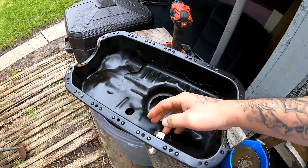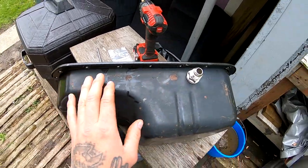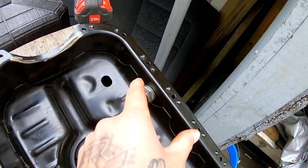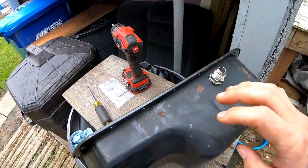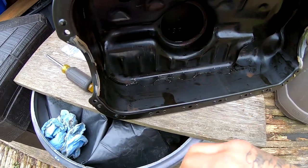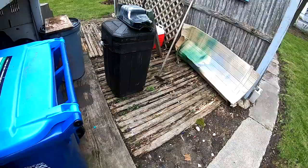I'm gonna take it off, and after that I'm gonna scuff the whole thing on the outside and give it a quick paint job so I don't have any more surface rust. I also like to apply RTV on the inside around the edging after it's all tightened down. Don't forget about the little metal shavings on the inside from drilling — you gotta make sure all those shavings are out. I'm gonna rewash and rinse the whole thing thoroughly since the last thing you want is one of those going into your engine.